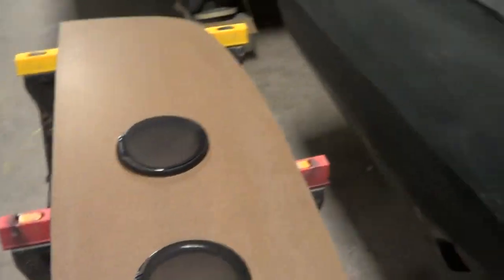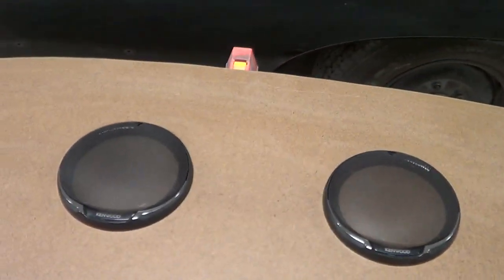I always use this — it's a factory piece. Nine times out of ten you're not going to be able to use your original because this is cardboard, there was moisture back here, these things warp, and it just gets real ugly. So we rip all that out, put a new one in, glue it down, and then install the speakers and so forth. There is a video showing the original package tray installed and getting ready for the wood and the masonite back here.